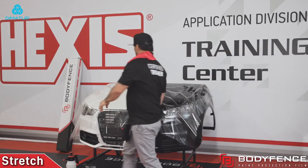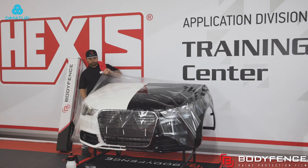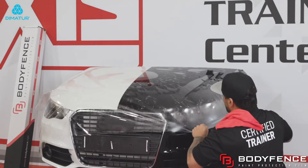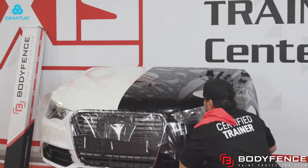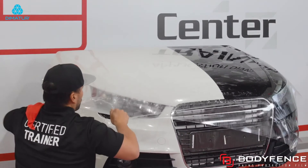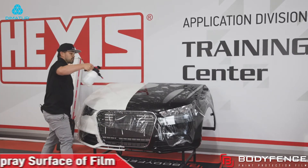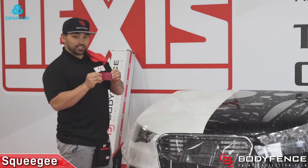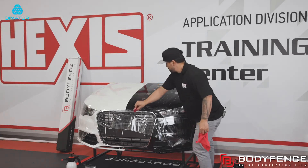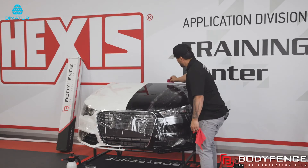Once the film's on the hood, we're going to stretch it in an X from the four corners. So I'm going to start with this top corner right here. As you can see, I'm stretching in an X motion. The goal is to pull the film to where it looks like everything is all ready to be squeegeed on a nice flat surface. Once your stretch is good, you're going to make sure you spray the top of the film with your slip so your squeegee can slide right across it. I always do a top tack line and push some of the air out, doing long overlapping passes, making sure the squeegee glides across the top. If you feel your squeegee catch, you're going to want to respray the top of the film with your slip solution.